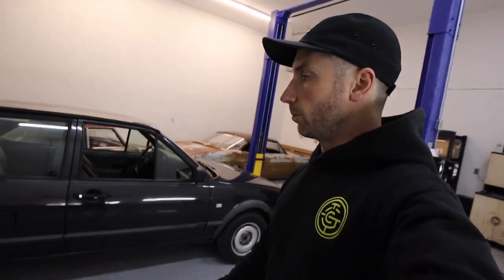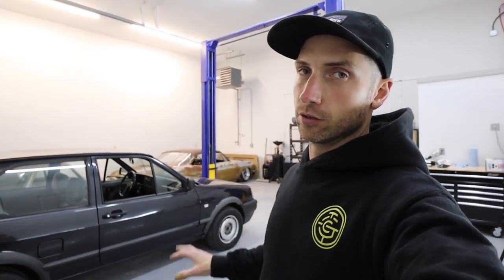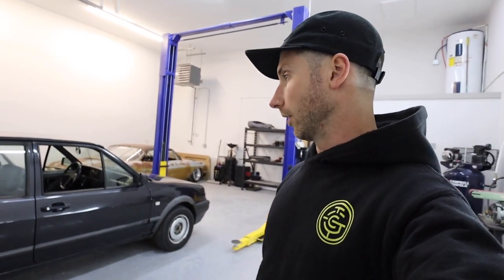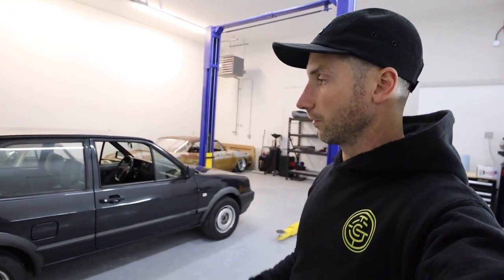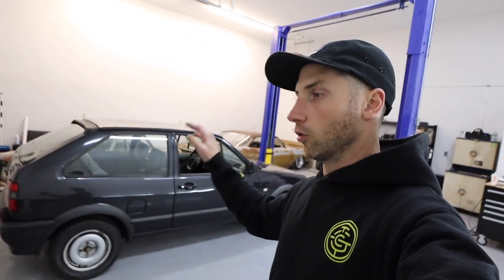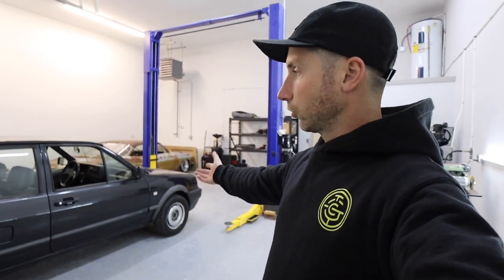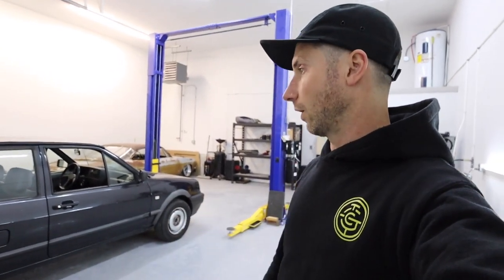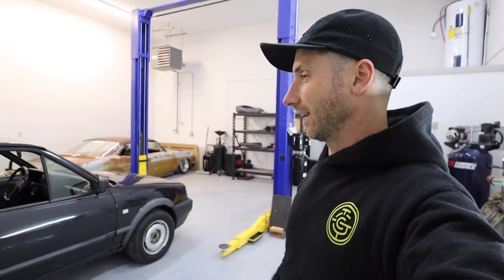The one thing I try to do before I start a project with a lot of suspension modifications, especially if I'm going real low, like the Corvair, the 700, or the Century, which lays control arms and engine cradle out on the ground, is get a measurement from the ground to the top of the fender arch at factory height, just to get an overall idea of how low it went. Obviously you can measure from the ground to the lowest point of the undercarriage before you lower it, and when that part touches the ground, you know how far you've gone. But it feels old school to me to measure to about 12 o'clock in the wheel arch and see how far it's come down.